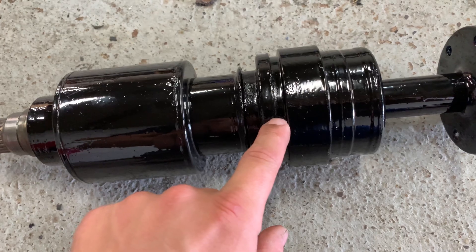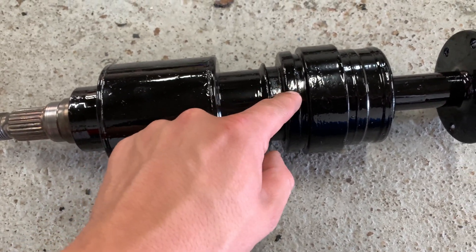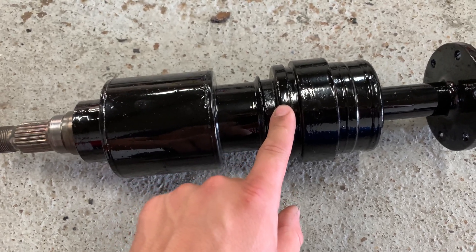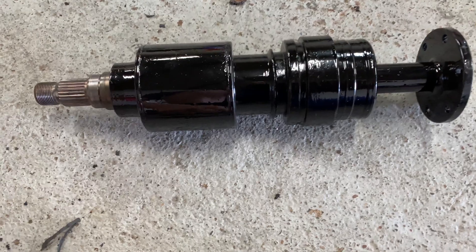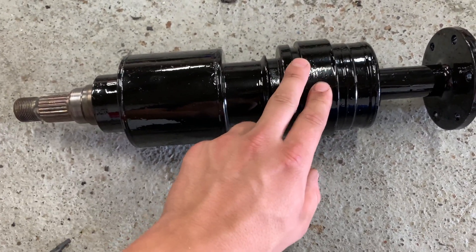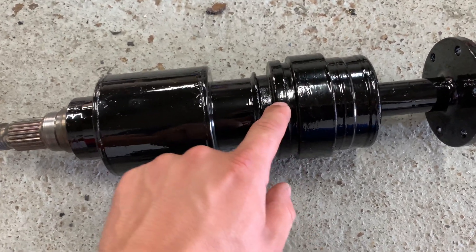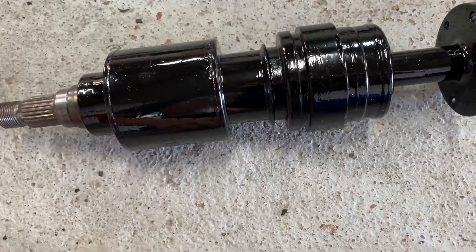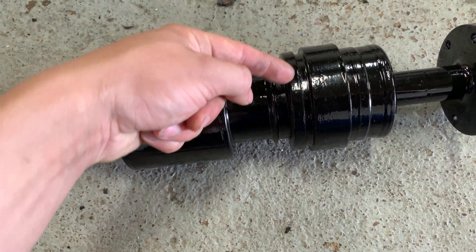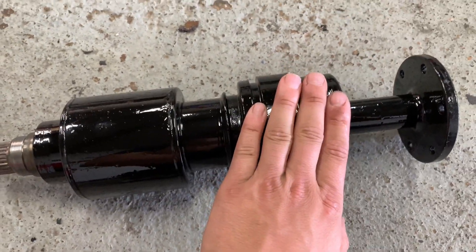What we're going to do is cut off this little dust shield right here, just cut a little slit here. Big thanks to my friend Rick who has a really cool 850 all-wheel drive that he dirt races — he says he breaks these freewheel mechanisms all the time on the dirt. So if he's breaking them on dirt, they're definitely going to break on the street. We're going to cut a little slit, pry this off, peel it off like a ring.